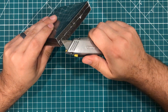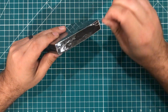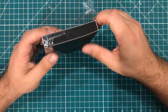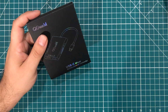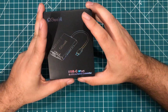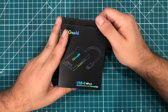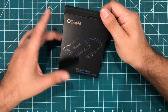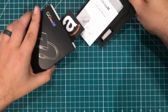I do have a few things like this. You've probably seen them on my channel. I've reviewed a few of them, and I will say one thing, a lot of people go in with bad expectations about the video. It's not actually up to this device whether your USB-C port can do video. That has to do with the actual controller on your PC. Generally, the ones that are listed as Thunderbolt ports can, but the ones that are not Thunderbolt, or that don't have some kind of display technology built into the USB port, probably won't output on this. But we're going to open it up.